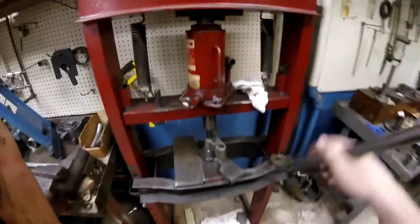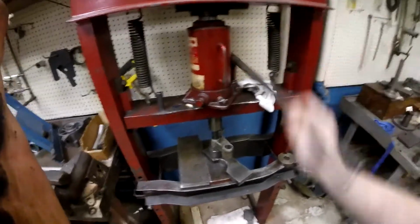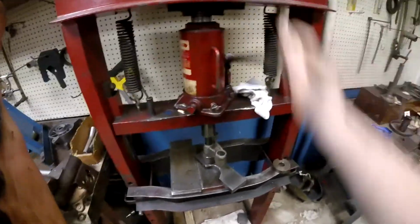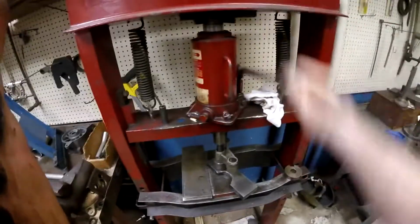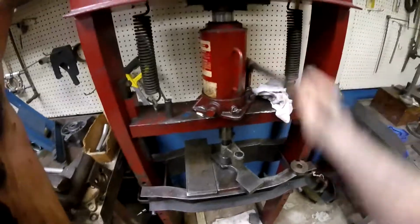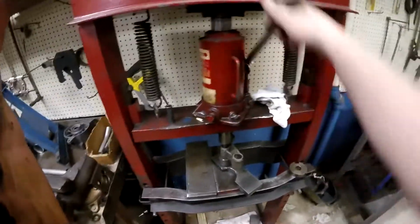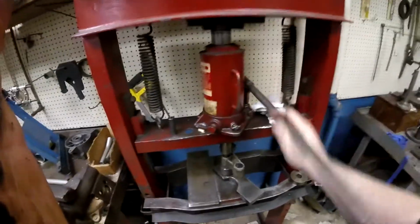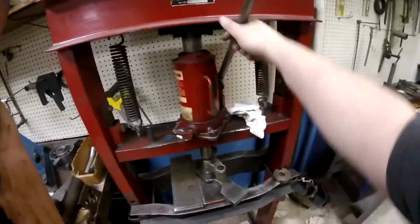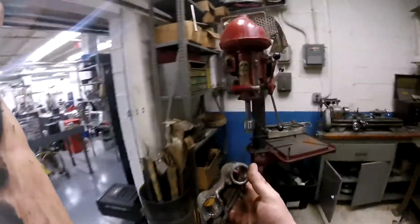And now that there's a hole in that big donut down there, these bearings should just go right through. Yep, there they go. See it walking around a little bit. It found home. It moved sideways about a millimeter. And then it started pressing. And you just keep going till you knock them all the way out. You'll know you got the last one all the way through because everything will get loose and flop around. There you go. All the old bearings and stuff, I'll pick them up and clean that mess up. But this right here is the part you want to bead blast and make it nice and clean. And then we'll come back and put the new ones in.